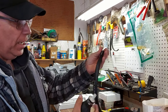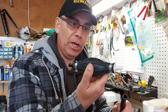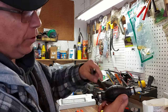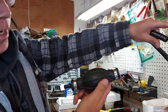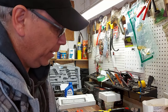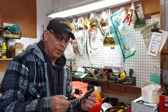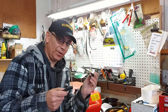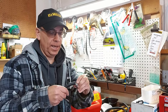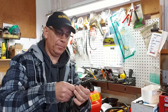What we have here is our bulb and our black fuel line. I cut this first piece about 18 inches. You want your short piece going from your fuel tank to the bulb, and then the long piece from the bulb to your motor. I've got to put the short piece on first — make sure the arrow is heading towards the outboard motor. Don't forget the clamp! We've got that first part done.